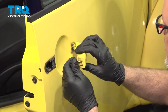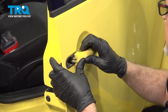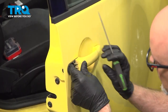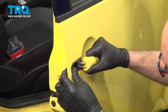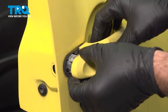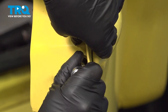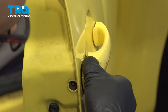Make sure this cable is going outward, then very carefully slide this in place. Slide the regulators in, get some of the bolts started, and raise it up so you can see where the bolt holes are. Tighten these down. Take the handle, reinstall that side, get it lined up, and take that cable — use a small pick to get it pushed in all the way. Lock it down and double-check that it works properly. Tighten this screw down and snug that down.